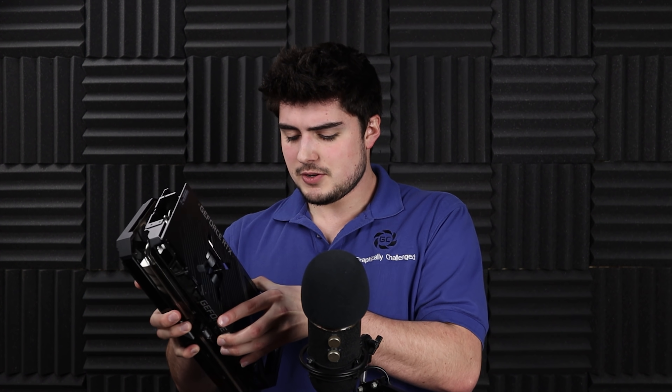The reason why this is occurring is that if you take a look at this cooler I have here on an RTX 3090, you can see that it's a very large, beefy cooler. You would expect it could handle the thermals of the RTX 3090 pretty well, even despite the fact that it's a 350-watt card. If we take apart this GPU cooler, we can see that on the front of the GPU it's making pretty good contact with not only the GPU die in the center, but also the thermal pads making contact with the GDDR6X.